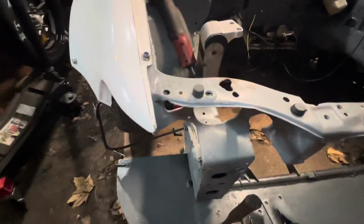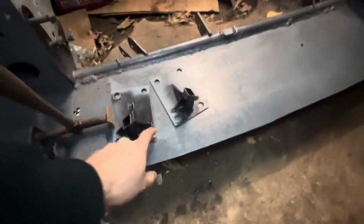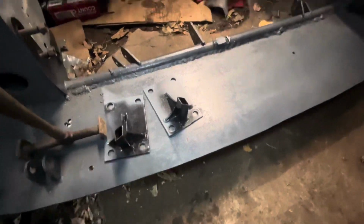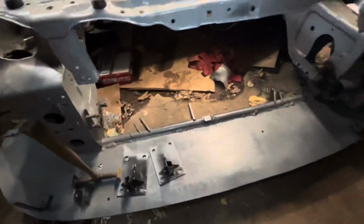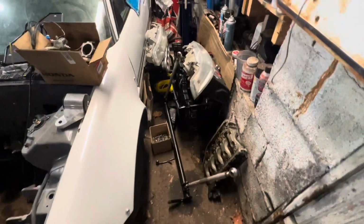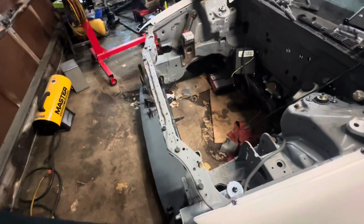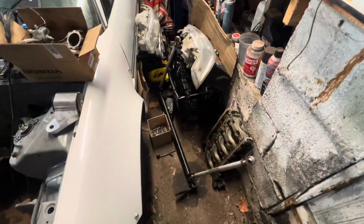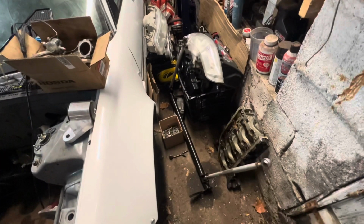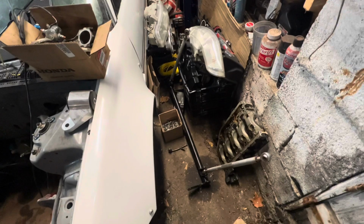My cordless blade got hot, so I had to stop, or else I would have finished the side for the battery box. But now I'm just gonna step drill out the holes for the mounts, and hopefully I'm able to shift the bumper over without an issue. And the other thing I couldn't remember that I wanted to do, I want to take these off the traction bar and try to fit it onto that one. But I sprayed them with PB Blaster, let them sit overnight, and hopefully the bolts should come out.